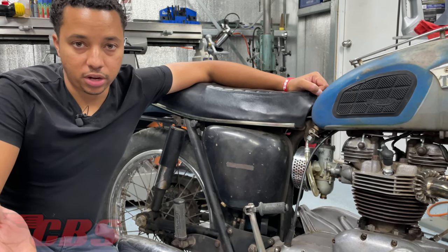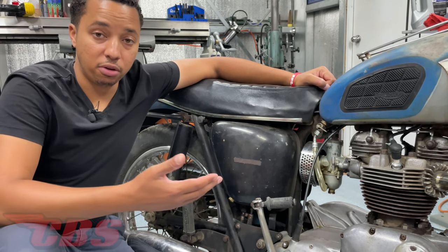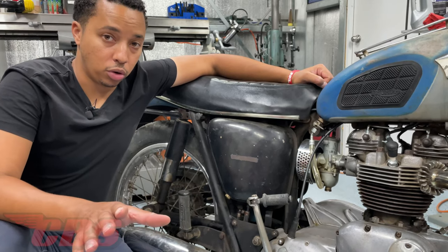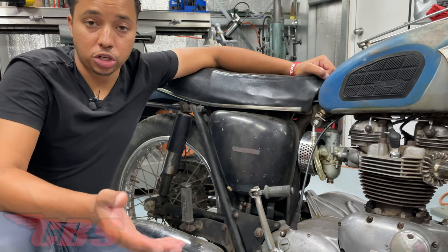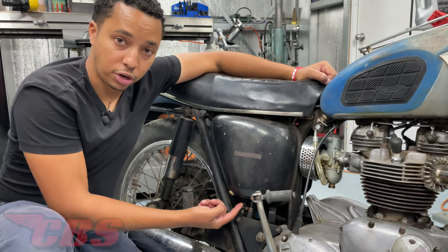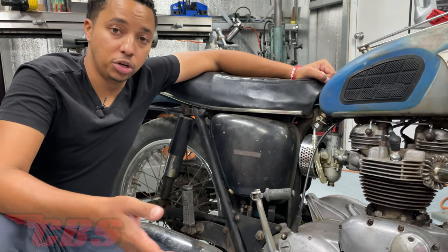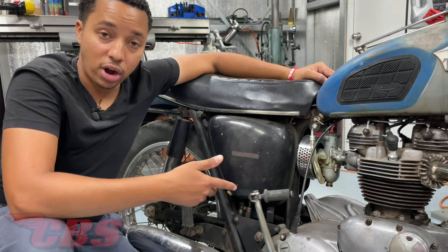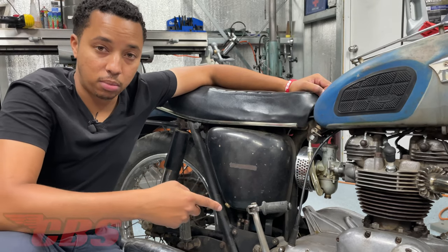The question often comes up, especially on the forums: when you're changing the oil, do you have to remove the filter from the tank and the filter from the crankcase? Like I said, if your engine's already been gone through and you want to do an oil change, just remove the plug and drain the oil. However, if you're concerned about the oil quality or there's any debris, there's going to be a filter in the tank. You can remove it, clean it, and reuse it — or if it has damage, go ahead and replace it. Let's start talking about the crankcase; we're going to go underneath the engine to give you a better idea of what the plug looks like.